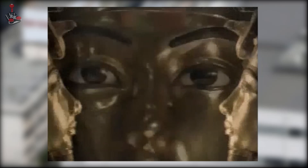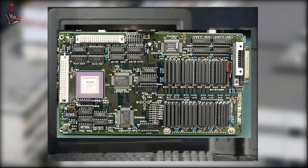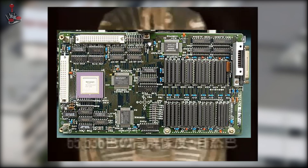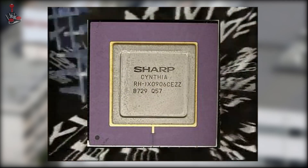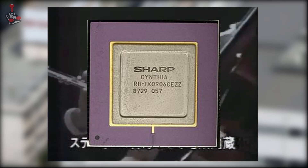Features like the soft eject floppy drives and the prominent volume knob on the front, for example. It could easily sit well with the mid-80s high-end stereo equipment, especially in the black. Specification-wise, this machine was a beast for 1987. The initial models sported the 16-bit Motorola 68000 processor, which gives it its name — the same CPU found in the Amiga and the Atari ST, among others. It also has a separate sprite controller chip codenamed Cynthia.